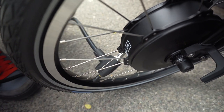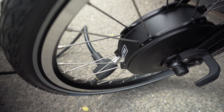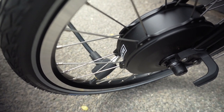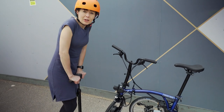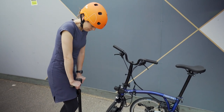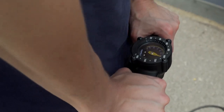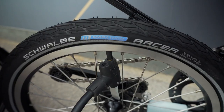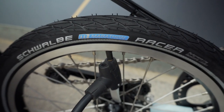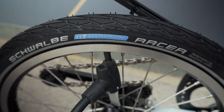We prefer to run them at about 100 to get the best performance out of our electric. If they're softer than this, your Brompton won't run so well and you won't get such good a range. This is best done with a track pump. We keep the little Brompton pump for emergencies. Normally a car pump won't go to a high enough pressure for your Brompton Electric.